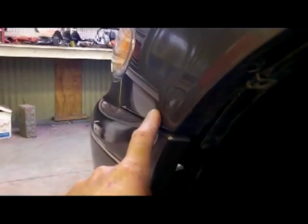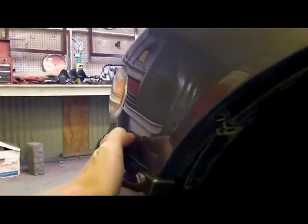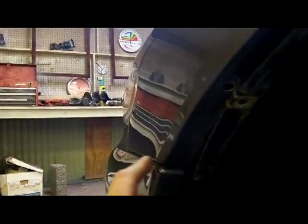And I've pulled the inner wheelhouse loose, back to zoom out here a little bit, and I got my hands up behind this and started tugging on it and got it out to where it meets the headlight nice, just like the other side. Now, I think I got a little something funky going on right here. Looks like this dips in right here. I'm going to try and work on that with my fingers and walk it out a little bit more. But I think we might call that fender happy.